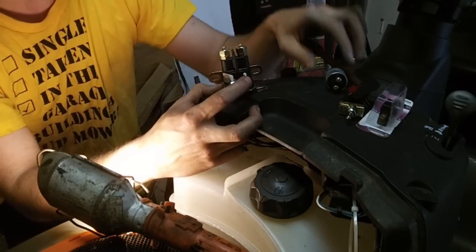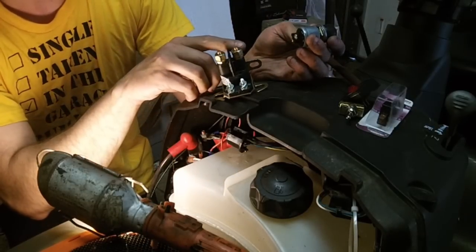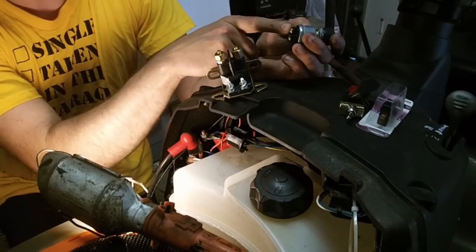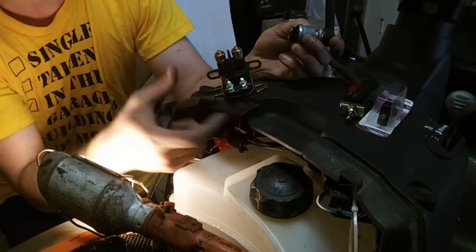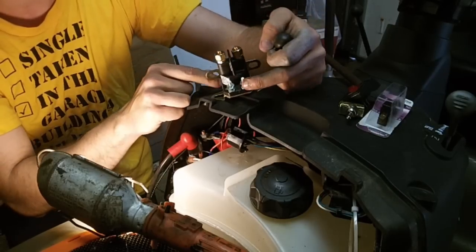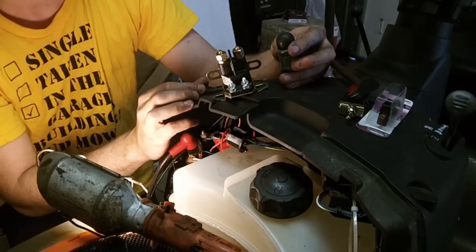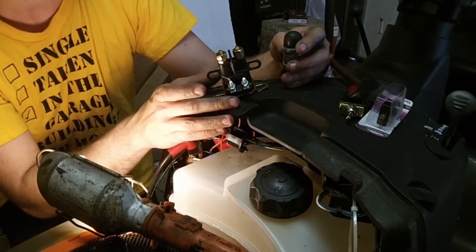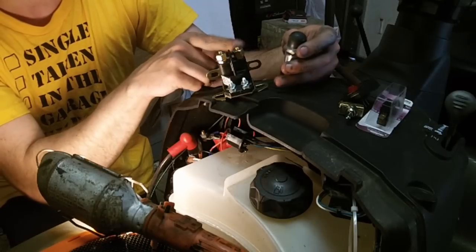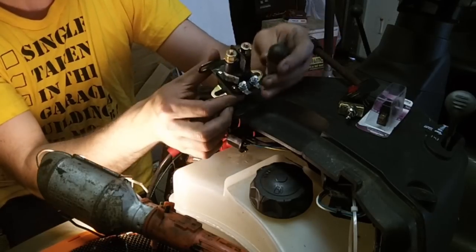This pole is going to connect to a ground, whether you have to wire one or splice into the harness. What's going to change is this is what hooks up to your push-button. You're going to take a lead off of the battery side of your solenoid — you can tell which one that is because when the machine is off, it will always have power. Wire that to one side, and wire the other side back to this pin on your solenoid. When you push this button, it makes the loop through, putting power to this, grounding out through this, and triggering your solenoid to start your starter. That pretty much doesn't have anything to do with the actual ignition switch itself — you're literally just making a lead from here to here, from here to this, and make sure this side is grounded.